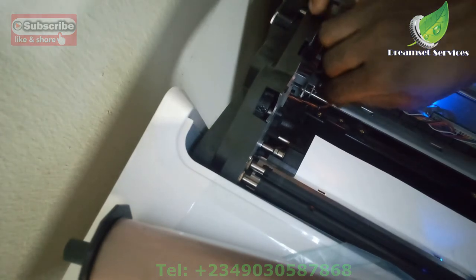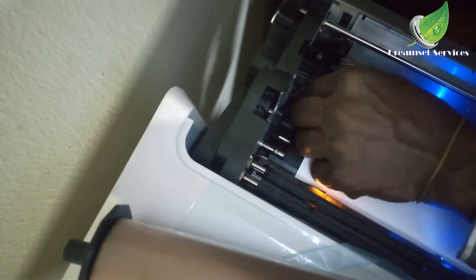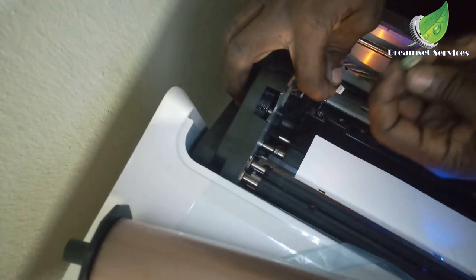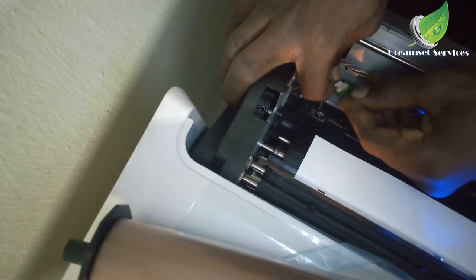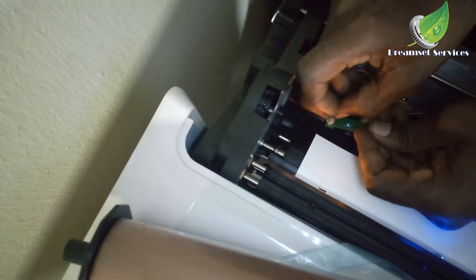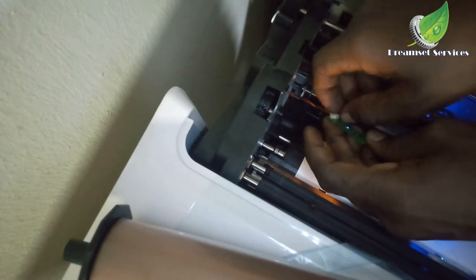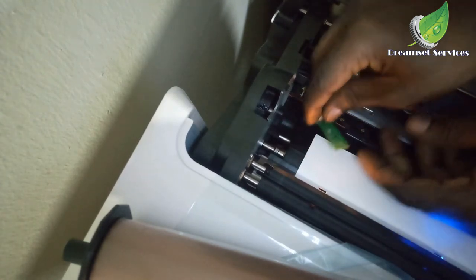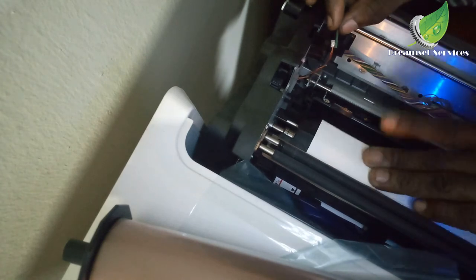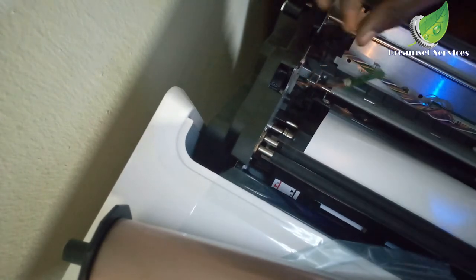I just want to check the cable to make sure everything is fine and there are no cuts anywhere around it. The cable appears to be fine. I will reattach the chip back to its slot and position it again, then power on the photo machine — and hopefully the problem is solved. Basically, when you get this error asking you to power on and off, it's because the printer is not initializing the way it ought to. When you power on and it doesn't spin or make that vibrating sound, the problem most likely is just with the photo paper not being aligned properly, or with the ribbon itself. I'm going to put the chip back.